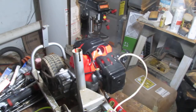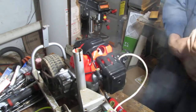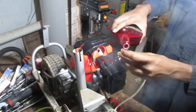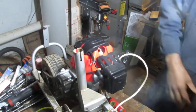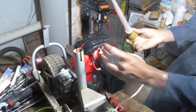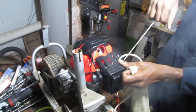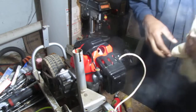So I do want to lubricate this top end a little bit, and to do that we're going to use a little Marvel Mystery Oil, not a sponsor. The reason why I'm doing this is because it's a brand new engine. I believe this engine is 25 to 1. Yeah, it's a 25 to 1 mixture.